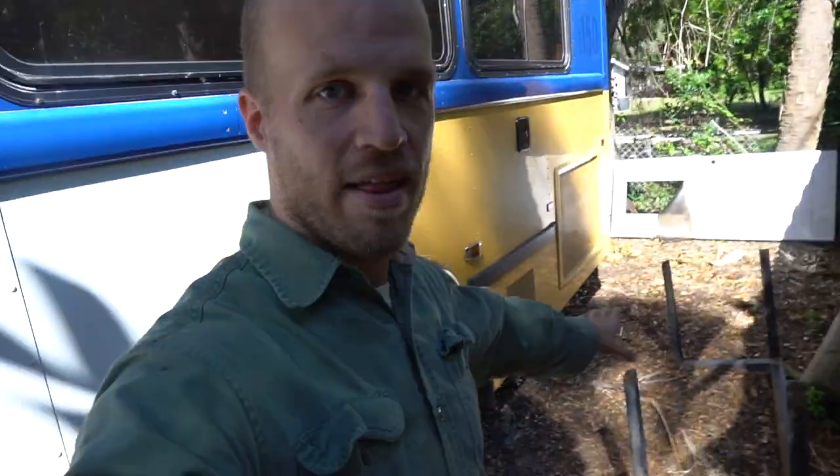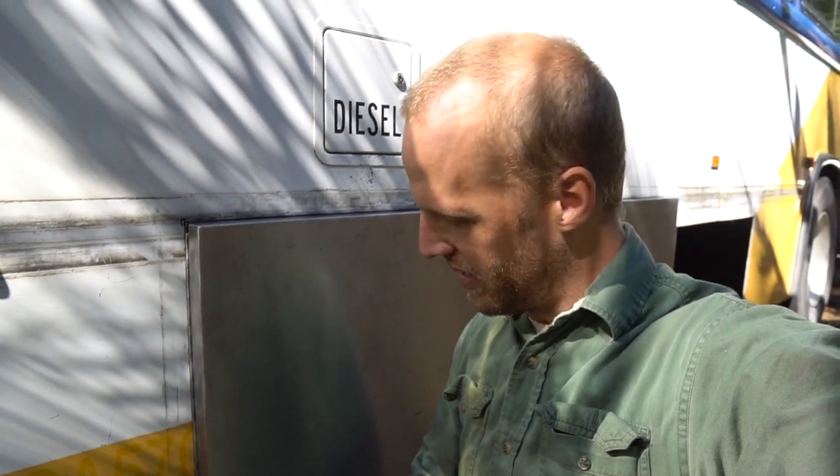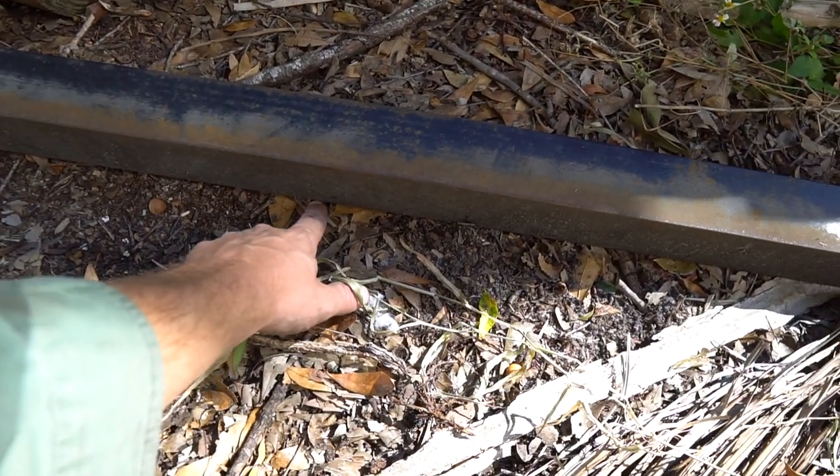Let's take a quick interlude and talk about mounting these storage boxes. The correct way, the way the manufacturer recommends, is being installed with their bracket — this is a really robust thick steel, that's how you're supposed to do this. The problem is: this bus at the skirt is 12 inches from the ground when raised up and the airbags are full. The fuel tank sits a little bit lower — the bottom of it is about 10 inches from the ground. The total space inside is a little more than 23 inches, but these boxes are 24 inches. So we are lowering the ground clearance by about half an inch to an inch. The bottom of the big bracket is two and a half inches deep, so we would be adding another two and a half inches underneath, making it half an inch lower than the fuel tank. We really don't want to lower the ground clearance of this bus anymore.